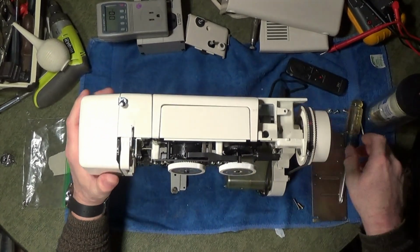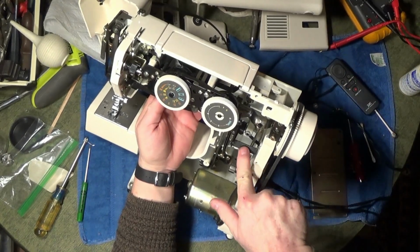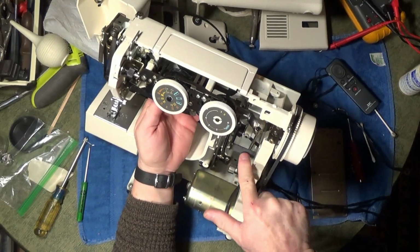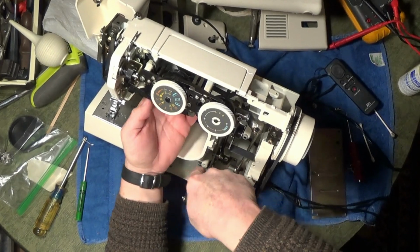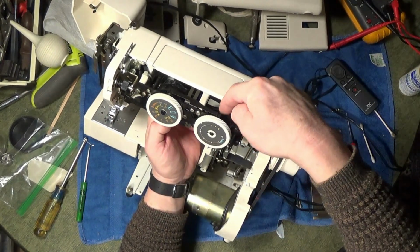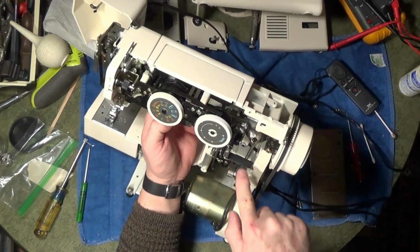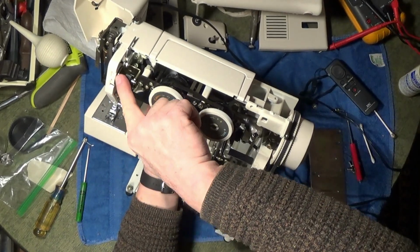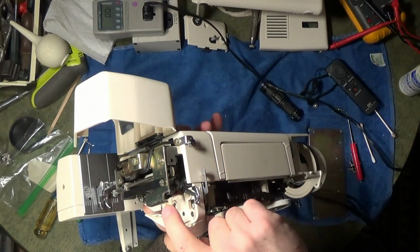First things first. Okay, I'm back. I was able to lubricate the reverse lever so that it springs right back. It actually is connected with a lever down to the bottom over here to a rod that pivots, and there's also a little bit of lubrication up here that needed to happen. But it pops back now instead of sticking.